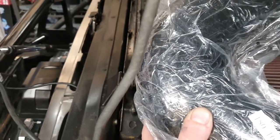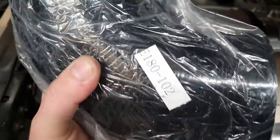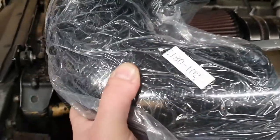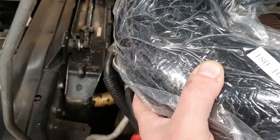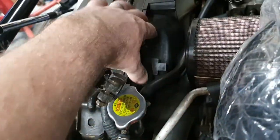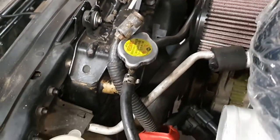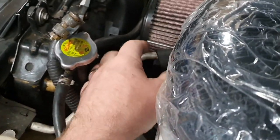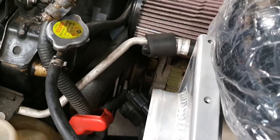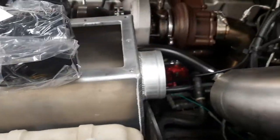Just the sheer length of that 180-degree bend — sorry about the hood prop being in the way — that puts the edge of this actually in the radiator. It's silicon so you can cut it; it's got reasonably long legs, you can probably take an inch and a half, two inches off, bring it back so we'd sort of clear the radiator, maybe not so much the fan shroud. This air conditioning pipe — we can be brave and bend that. If it gases out, well that's the way it is. We tried to make it work. It's not going to be a walk in the park, but I think we can make it work.